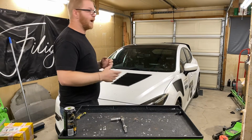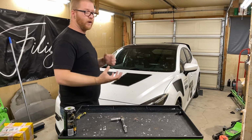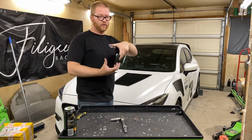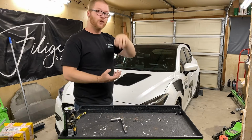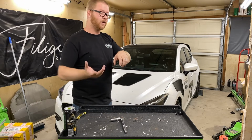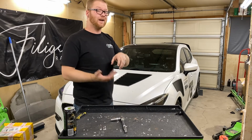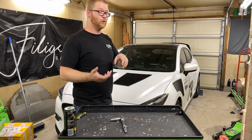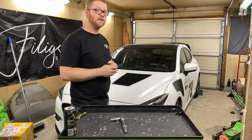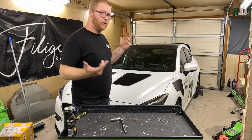my gas evaporator. For some reason it's reading pressures too high. When we were bolting in the harnesses, one of the anchors for the harnesses went right next to the evap hose. So I'm going to go through them. I'm going to make sure that that's not kinking that hose or anything weird like that. I mean, that's my first guess of what's going on there. Beyond that, I don't know why it would be too high.